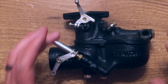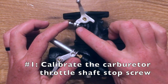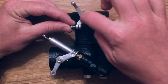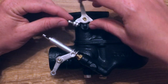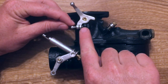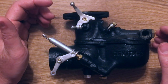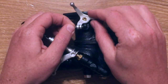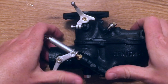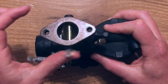The first thing you want to start with calibrating is the throttle shaft stop screw, right here. This is a Zenith carburetor — I've got it off the car here. Your throttle shaft lever is this thing that's pivoting, and right here is the throttle shaft stop screw, also called the throttle stop. This is a screw that sets the minimum opening of the throttle valve. As you screw it in or out against this stop, it changes the position of the butterfly valve, right here, which controls the throttle.